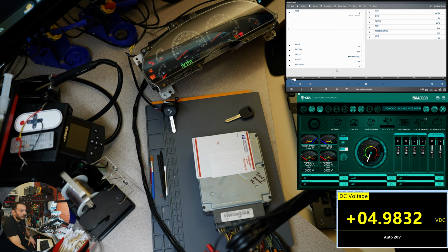I'm going to inject RPM through here. Forgot what signal I have. I have signal 7, which is for higher RPMs, which is okay. So let's start with 1,000. Yeah, but we got nothing. So we are injecting, and hopefully you can see in the cluster, nothing is being recorded.